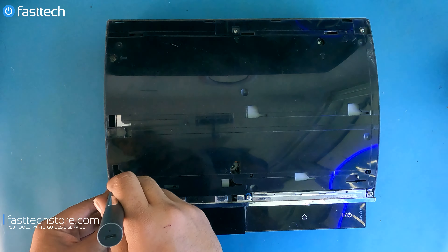Now we're going to put this piece back in, which holds the security screw in place. We're going to put the case right about here and tighten the screw — this is going to be tricky the first time you do this, but eventually you'll get it right. The Torx T8H goes back in our toolkit. Now I'm just going to tighten the screw all the way. Now we're going to put the rubber stop back in — hopefully yours is in better shape. The job's done. The thermal paste has been replaced.